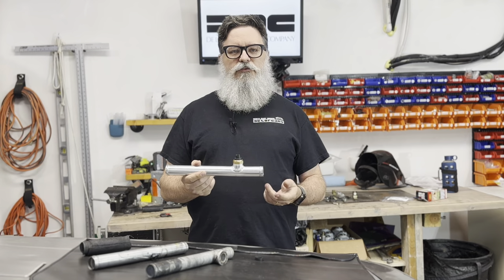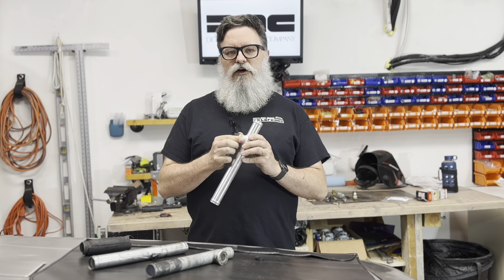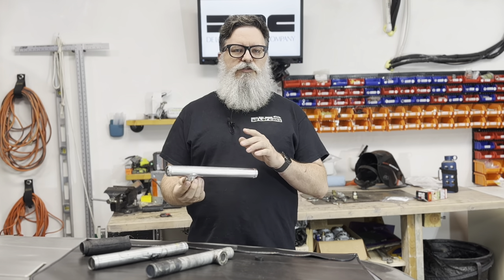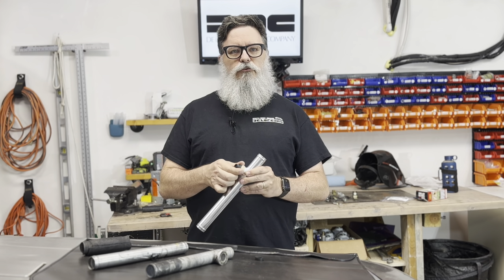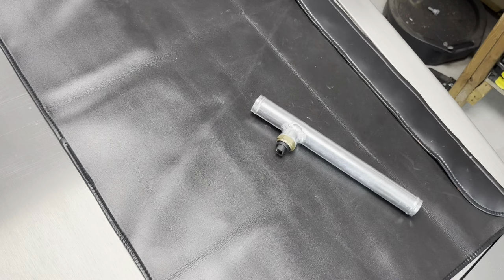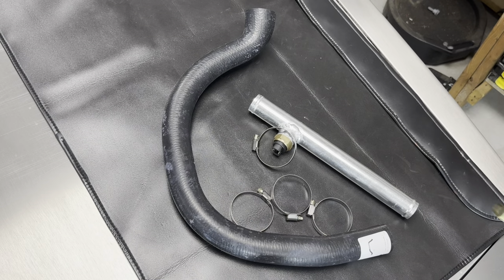This is a new-style Otterstat pipe available from some DeLorean vendors. It has a pre-installed screw-in Otterstat, without the gasket or the fiddly clip, so you don't have to worry about it failing if you mount it upside down. In my case I don't actually need the Otterstat, but it'll serve as a glorified plug to keep the coolant in the car and get me on the road quickly. I'm putting this in along with a new water pump hose, properly sized hose clamps, and mounting brackets.